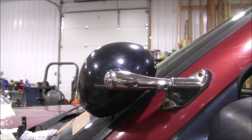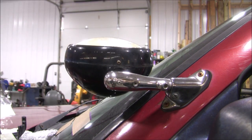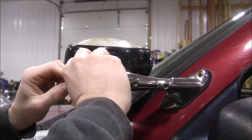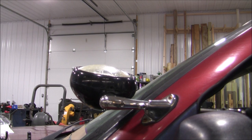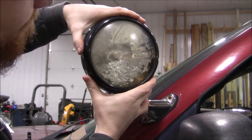To start the replacement, you'll need to remove the small screw on the bottom. I used a 3/32" Allen wrench to remove it. You'll see mine is quite rusty, which will give you a guess on the mess we'll find inside. After that, you simply turn the outer ring counterclockwise and the lamp will be able to come out.